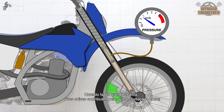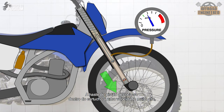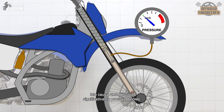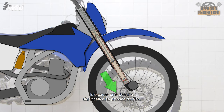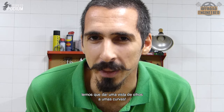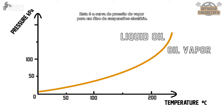When repeatedly doing large jumps, two things will contribute to cavitation happening. The piston rod inside the cartridge travels at a really high velocity, not giving enough time for the piston rod chamber to get filled with oil, causing the oil pressure to drop significantly. The oil inside the forks also starts heating up. To understand why this is important, we have to take a look at some curves. This is the vapor pressure curve for a random fork oil, and every liquid has a vapor pressure curve. This line represents the pressure at which a liquid boils, or changes to its vapor state, at a given temperature.